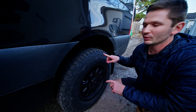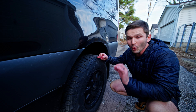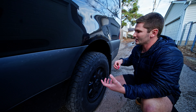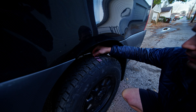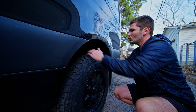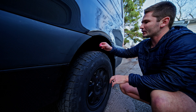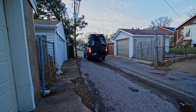This is the driver's side rear tire — the one we're really testing at the new tire pressure. The door sticker cold inflate for this tire is 70 psi, and David was seeing pressures spin up to about 75 psi on the highway. We're doing the chalk test by drawing chalk across the tread blocks from one side to the other. The whole idea is you want the whole tire touching the ground — full contact across the tire. That's how the tire was designed to operate, not with just the center on the ground and the edges barely contacting the road, which results in reduced contact patch, poor handling, and longer braking distances.